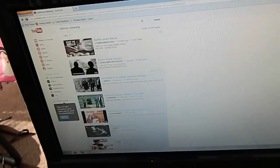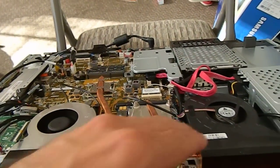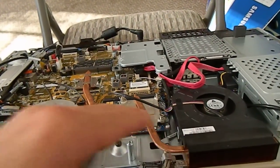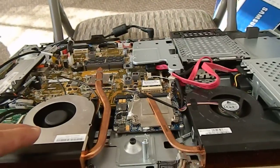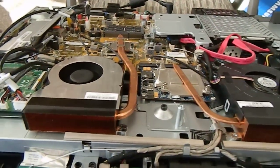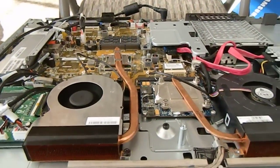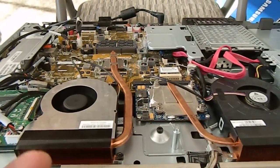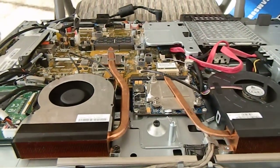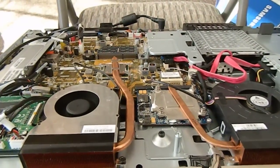You can use any features. Just some advice: once you have the computer open, make sure that you clean your vents — your fan vents — and both the graphics card and the CPU fan. Make sure that you clean them before you put it back together. If you're having an issue where the screen is going black but the computer is still on, this is how you fix the HP 600 1000 series.